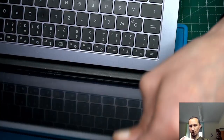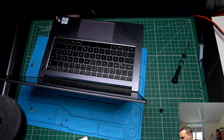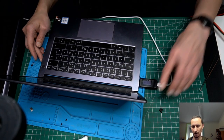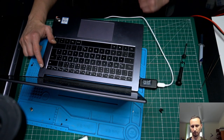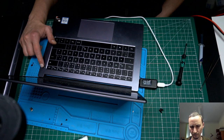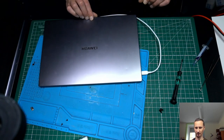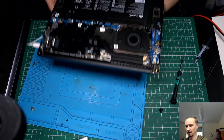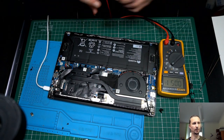You have to make a restart to let the machine know everything is fine. Yes, you can charge. Let's just try that first. Power. Turning on 1 amp. No boot device, I'm okay. We are definitely charging, and we confirm that when we measure the battery voltage rising.